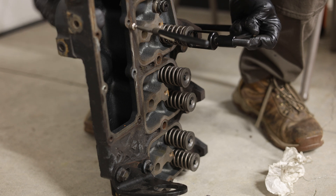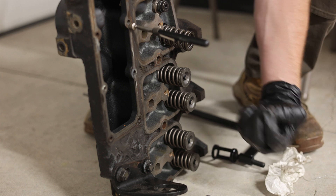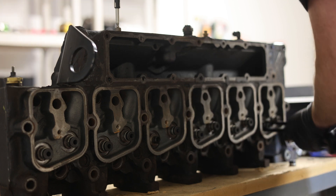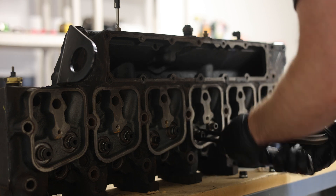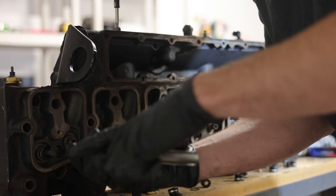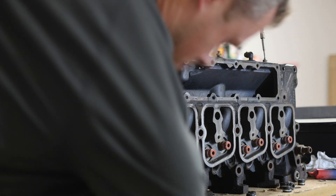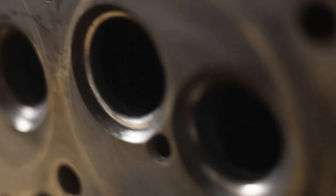If you're planning on going past 3,500 RPM, this would be the opportune moment to also install your 62-pound valve springs. This is going to be a stock rebuild, so no need to go crazy with it. The old valve stem seals actually look pretty good, but you can see me removing them here because sometimes they're more brittle than you think and we've got a whole brand new set that came with the kit, so we should use those. I'm also using a valve stem seal puller — it's a specialty tool, I think you can get it at Harbor Freight. Installing them, you just push them in with your thumb and I used a brass hammer to gently tap them in, making sure they're seated all the way.